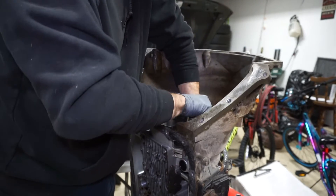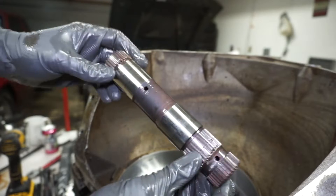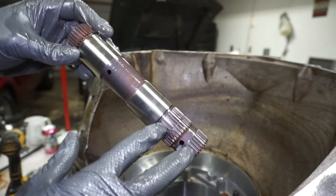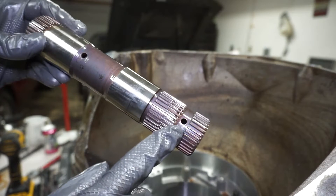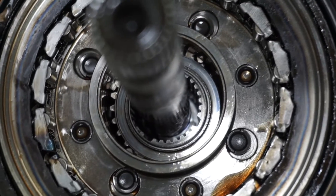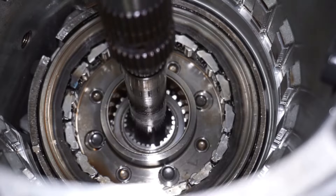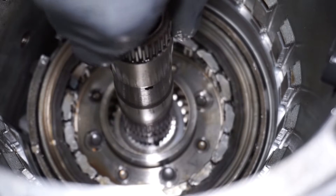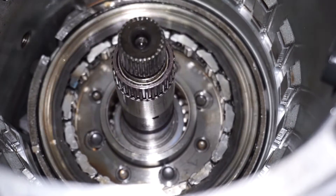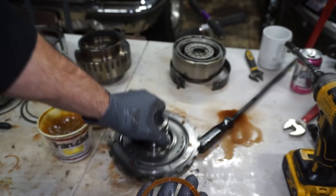I can drop it straight down — good to go on the rear section. Next I can drop the sun shaft in. The part with the double spline on the back goes towards the back, and this lube hole right here should line up with the notch. There's actually a wider gap between the splines — that's the little notch I'm talking about. There are four of them on that gear, so I'll take the bottom lube hole on the sun shaft and slide it down and try to line it up with that notch. Next I'll take the thrust washer that goes underneath the center support and put that on.